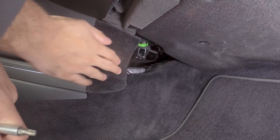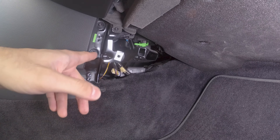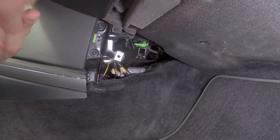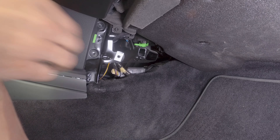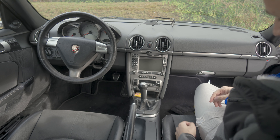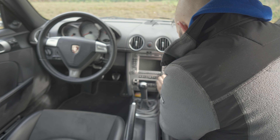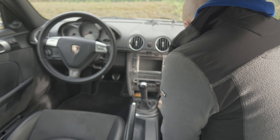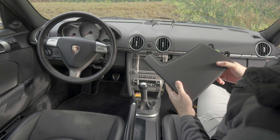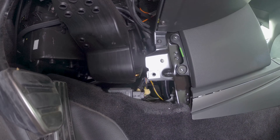We start by removing the side panels. This piece of trim needs to come off, which I'm conveniently blocking with my hand. There are Torx bolts holding the side panel — I think it's these two here. T20s it is. So this is all removed now and I should be able to get this away. Now that I've loosened the bolts I can just pull this away — maybe opening the glove box a bit. Yep, it's off. That was quite easy, and I have to repeat the same thing on the other side. And this is out as well.